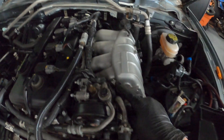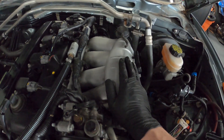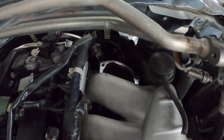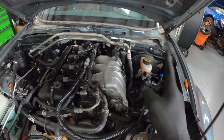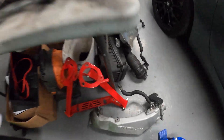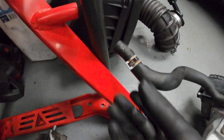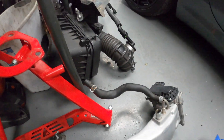The intake arm that goes across the top is broken at the front, so it's not being supported at the front. It's not the end of the world, but it doesn't appear that there was any sort of sealant on the back end here — that's not the best thing. And then the brake booster where I took it off — there is a crack right there. This thing probably had an occasional lack of sufficient braking.